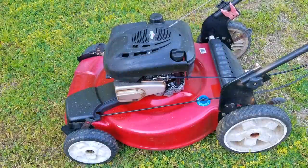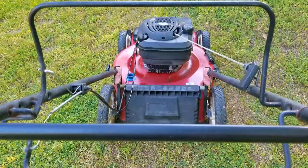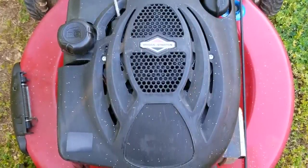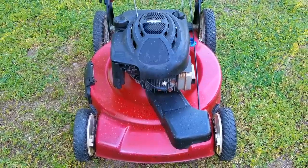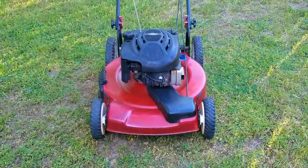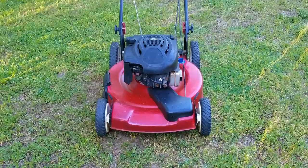This mower went from being very difficult to push to very easy, and when the buyer moves it, they're going to realize just how nice it is. So after a year of having this mower sitting around, it's finally running well, not shaking anymore, and it's super easy to use, even if you don't feel like using the self-propel. If your mower is shaking a lot and you think you might have a bent crankshaft, try out my test and see if your camera can pick up if it's bent. If it isn't, there's a good chance your blade is the issue and it just needs to be replaced. My question is: have you ever given away, thrown away, or given up on a mower that you thought had a bent crankshaft? I know I have, and I've sent a few to the scrapyard, but only after taking all the parts off I could use. Thank you for watching — please feel free to ask me any questions about this project or your own projects, and I hope to see you in the next video.